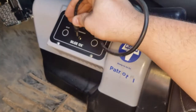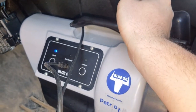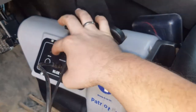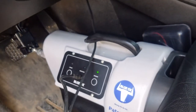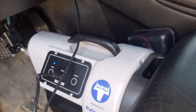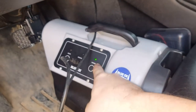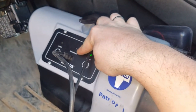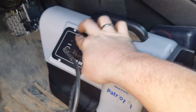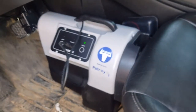I run the breakaway wire through the top and then plug it in. Push the power button — it blinks back and forth, which means it's ready to sync. Press the setup button, and as long as that's green you're ready to go. The breakaway light will turn orange when the breakaway activates. I've never really had an issue with the setup. That's how you set it up in the car.